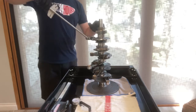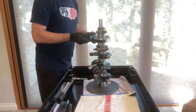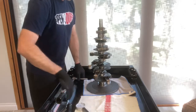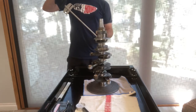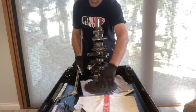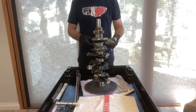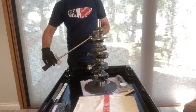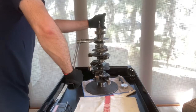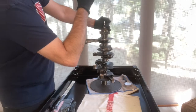The process that I would use is I would gently torque down the bolts, approaching 50 foot-pounds. So when I got to around 40 foot-pounds of torque, I would start measuring the stretch of the bolt. I use a simple beam-type torque wrench, maybe not the most precise, so I wanted to make sure that I didn't torque it down all the way to 50 foot-pounds and then try to take a stretch measurement. It actually ended up being very close. Using the torque wrench, once I got to 50 foot-pounds of torque, it was pretty close with each bolt in terms of getting it within that range of stretch. However, with each bolt, I set everything based on the stretch measurement.